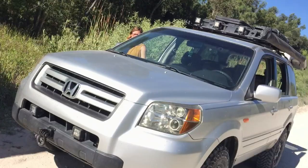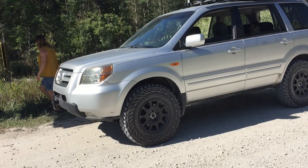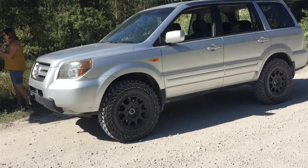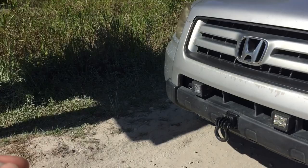I'm going to air down the tires today and I've always wanted to know how much skid plate height I lose when I air down. Currently my 235/85/16s are aired up to 40 PSI — that's what I aired them up to to tow. I'm going to air them down to 18 PSI today and see if they soften out the potholes and washboard roads. What I'm using to measure my skid plate height is a stick.